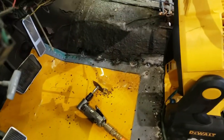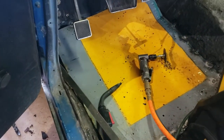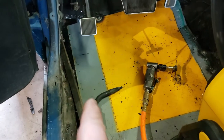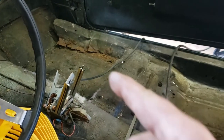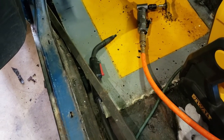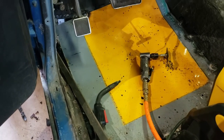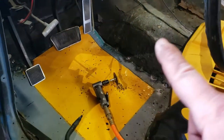We have the floor pan all tacked in place, looking good. Now I just have to do this corner here and this edge. If you look on that side, you can see there's an actual piece that comes over, so I'm going to make that and tack that too, then check underneath and fill whatever residual or leftover hole on the bottom. So we're going to build this out, and yep — that's where we're all tacked in, all the way across.